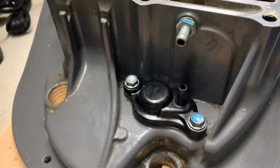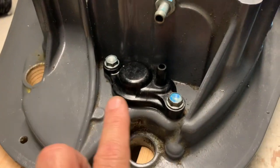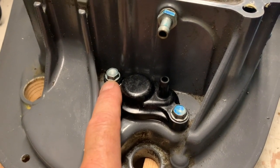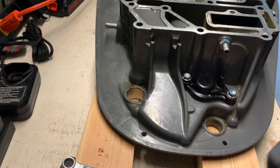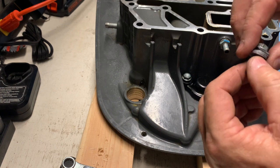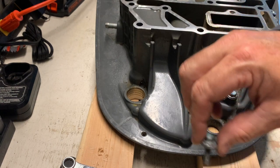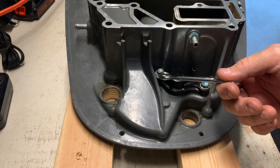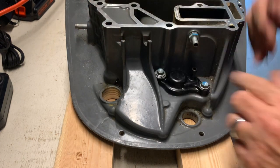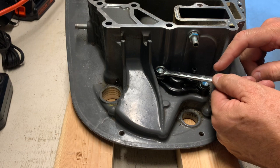Here's what the water pressure relief valve looks like on the mount case on the bench. The back bolt is difficult to access. To make future servicing easier, stack about three stainless steel washers on that back bolt with a dab of gasket maker to hold them together. This raises the bolt just enough above the cover to get a regular closed-end wrench on it at an angle, without needing an offset wrench.